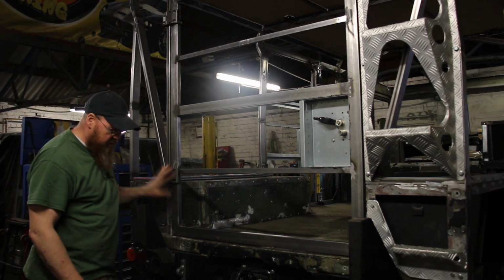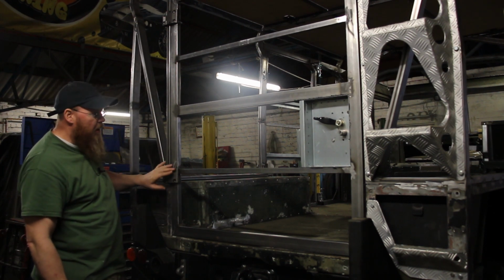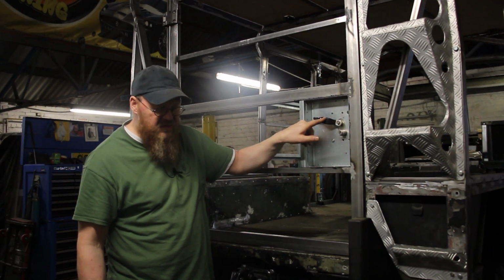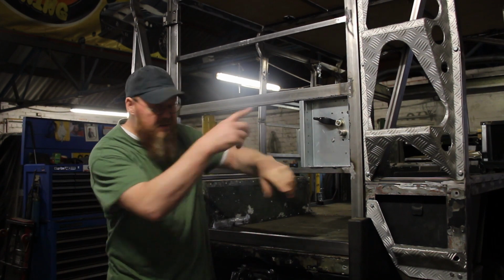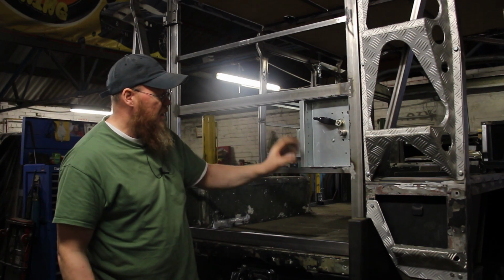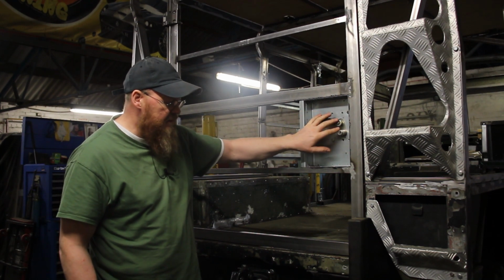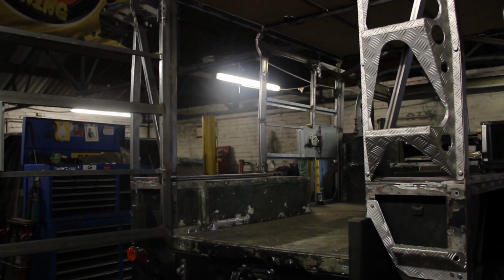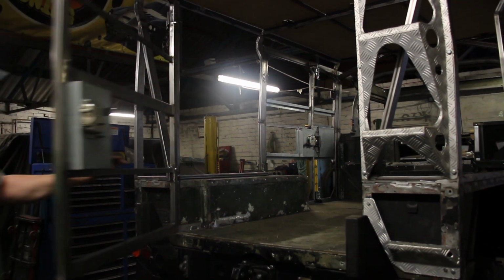But anyway, so Series 3 early Defender hinges to mount it on, same with the locks. I think those are Series 3 early Defender locks and pins. I made the frame up. I used two sheets of 1mm galvanized alloy to make the frame to put the locks in, and so there's the door. As you can see, the lock. So we've got that.